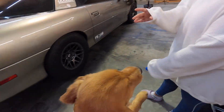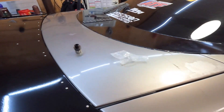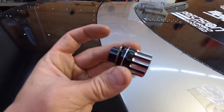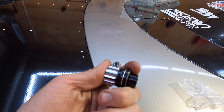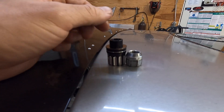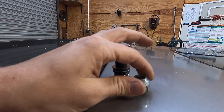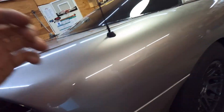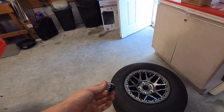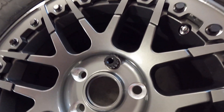Pretty excited to have fresh wheels. So remember I was saying I had these wheels machined out to fit a different style lug nut. This is a conical style lug nut - not exactly safe for drag racing. And this is the lug nut I switched to, which is a billet shank style, deep-reaching lug nut, so you get a ton of threading - like double the amount of threading - so a lot less likely to break. These go in the wheel and help center it too. A lot safer, plus they're a little lighter. They also look better and it was a necessary thing to change.